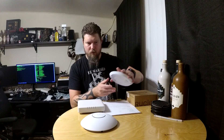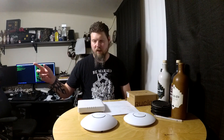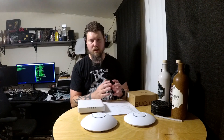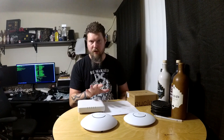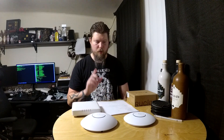As much as I thought I could do mostly 5 GHz in this home, it's not the case. My printer is 2.4 GHz, my laptop is 2.4 GHz, all my smart switches all over the house are 2.4 GHz. There are too many devices that need a good strong 2.4 GHz signal. So that's not a good fit either. In retrospect, the best Ubiquiti access point for me — without going into the really high-dollar stuff — would have been the UAP-AC Pro.